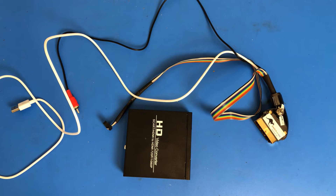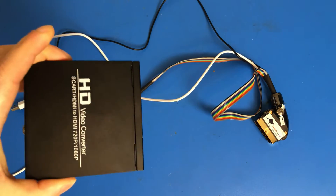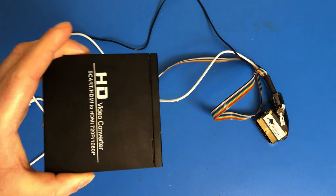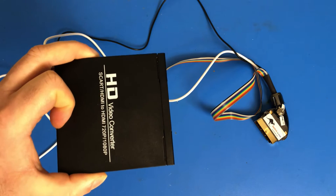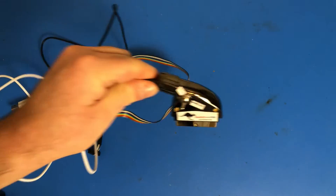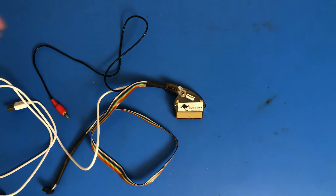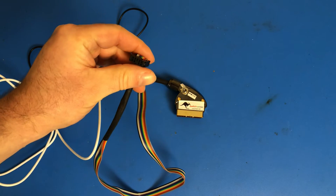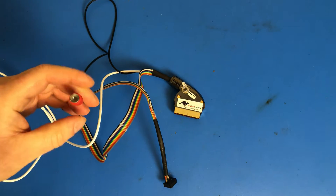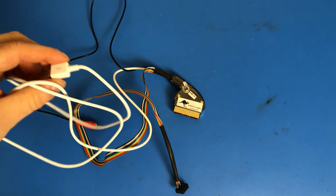This is basically everything you need for hooking up your RGB connector on your Tandy Color Computer 3 to a modern HDMI TV. This is the SCART to HDMI converter box — I bought it off Amazon for about $55. You want to make sure you get a fairly decent one; the cheaper ones don't go to nearly as high a resolution, so it will not make nearly as much of a difference. And this is the switcheroo cable from cocoamand.biz — I will put a link to the website in the description. This is the SCART connector which goes into your SCART to HDMI, this connects to the bottom of the Color Computer 3, this goes into your composite video out, and this is a power cable — it has to be hooked up to a 5 volt power source.